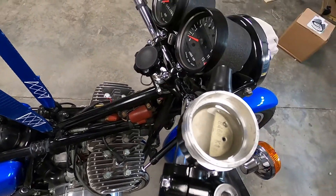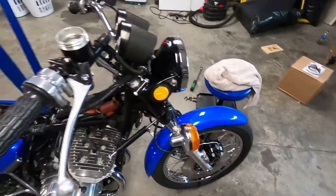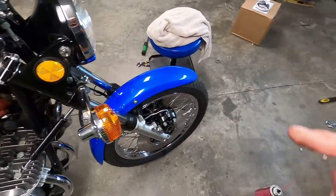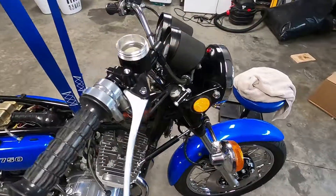I've got all the fluid into the master cylinder. You can either gravity bleed the brakes again or pressure bleed them. In this case, since I've done a new master cylinder, a new splitter, and a new caliper, there are a lot of places to get air bubbles, so I'm actually going to pressure bleed it.